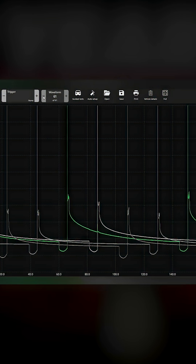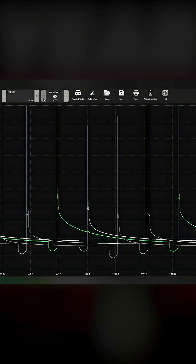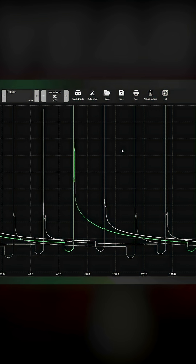That was still on cylinder three — this is a bad plug. You can see how much higher that line is; that's probably your best shot right there. Still on cylinder three — bad spark plug, cylinder three. It's not a bad coil, it's just a bad plug. Easy stuff, man.